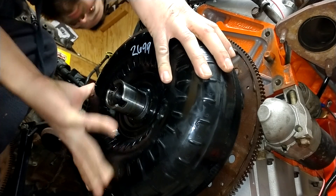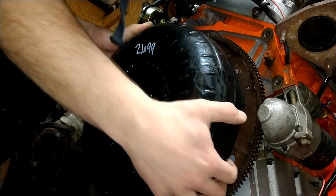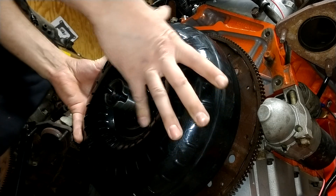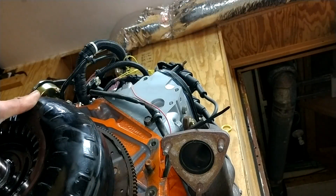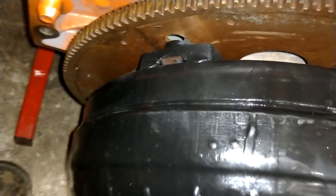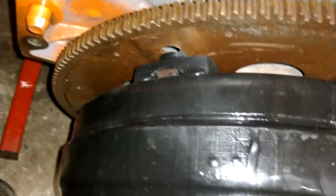While I'm holding this in place, you'll notice the bolt holes don't match up. The 4L80 torque converter uses a really wide metric bolt pattern. You look at the bosses versus where the holes are — you're off by about three-eighths of an inch. You can either spend the money and buy the correct flex plate for the application, or what I'm going to do — because you've got plenty of meat there — is simply take a die grinder, a Dremel, or a high-speed straight grinder with a carbide bit and open up those holes just a bit so you can get a bolt through. It's not a big deal.